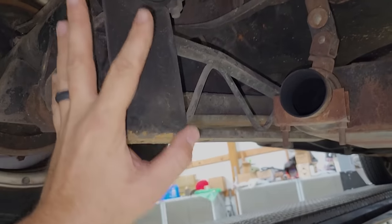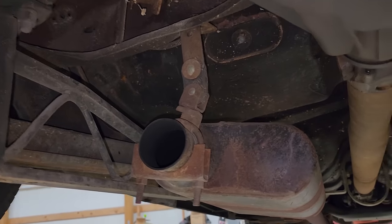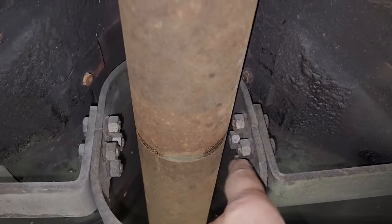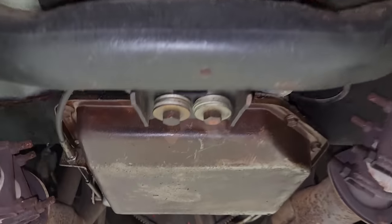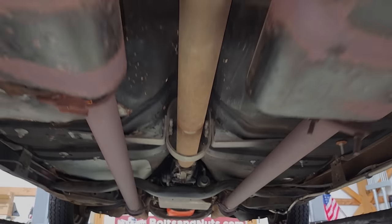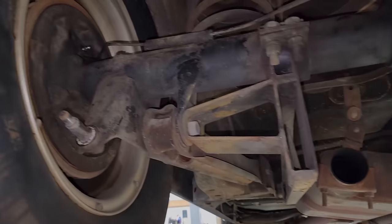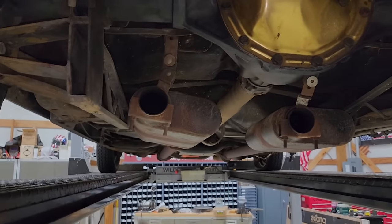I never really laid into her all the way, but man, this thing is rowdy. Tell you that. I also got this weird thing going on where the driveshaft is bumping against this, and this already looks like it's over, so I need to maybe look at the trans mount. Something going on there. It might be just a little bit shifted causing that issue. I don't want anything to go wrong on the rollers because it could just compound the issue and really tear up stuff here.